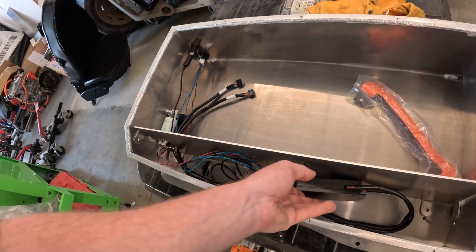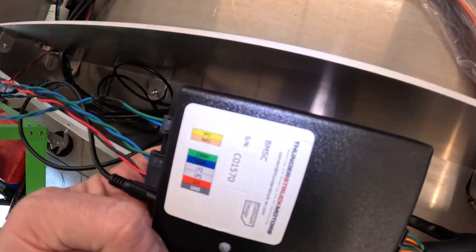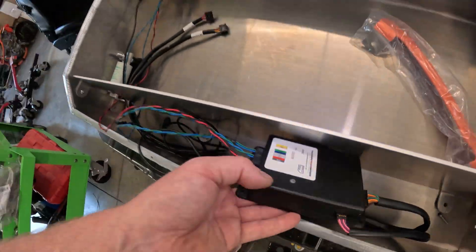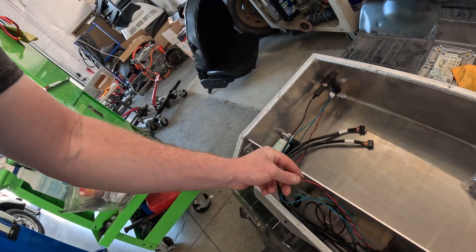There are a couple of CAN bus lines — a CAN and then an IMO line in orange and yellow. That wire goes to the rear battery box to the BMS unit in the rear, which has the same cell taps to the Tesla modules. It just needs 12-volt and ground to power it all.